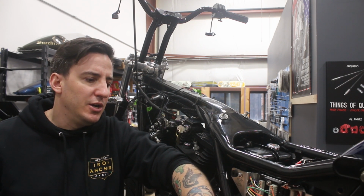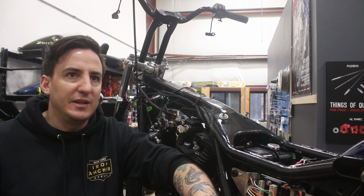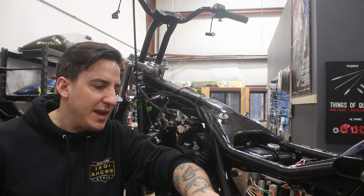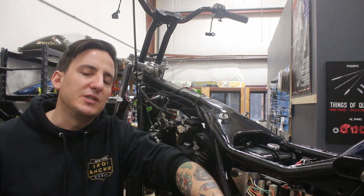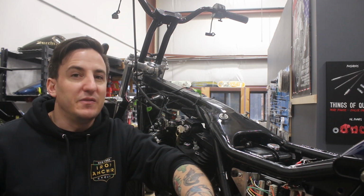I think there are certain things that the factory harness, you'd have to modify to run some of this stuff, like LED turn signals comes to mind. This manages those loads automatically, whereas obviously the factory system, you'd need to put load equalizers in. Those are inexpensive and easy to wire in.